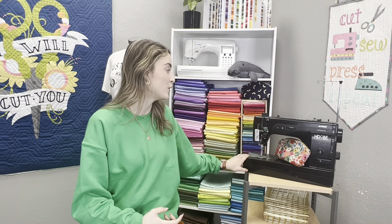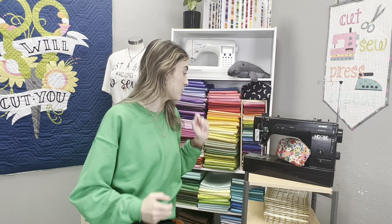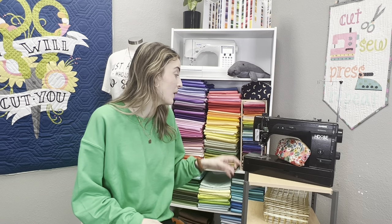If your machine has been serviced and you're still having tension issues, let's go over all the good stuff you need to check. The first thing on the list is threading. I know it sounds silly — how can you thread the machine wrong? — but everything on your machine made for threading has a purpose. If you're skipping a step or one of these little notches, it's going to throw everything off course. If it's there, it's meant to be used.